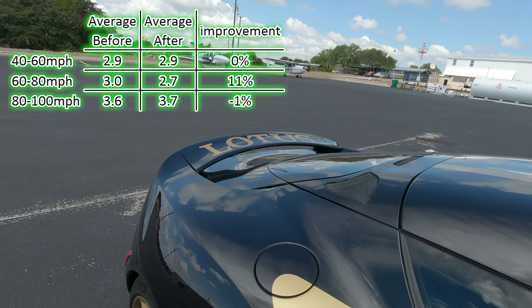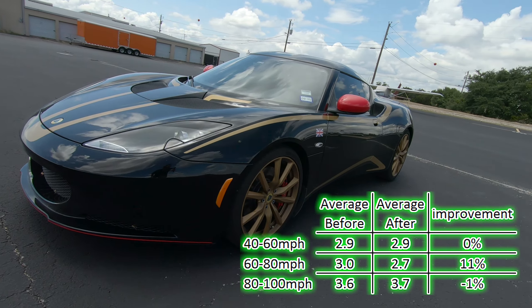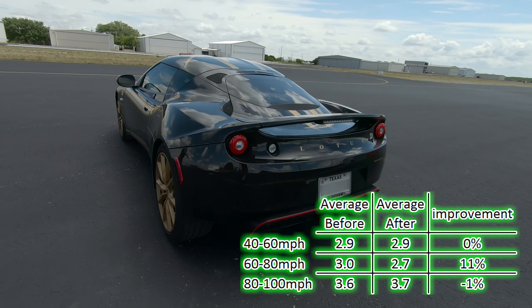That's pretty incredible. How do you feel about it? I like it. It's not an annoying sound — it adds a little extra dimension. Plus, 11% on the mid-range pull — that's pretty good. In my book, I think that's what I was feeling earlier that I was hoping was reality, and it seems to be. After crunching the numbers at home, we can see that there was zero improvement on both the high end and the low end of the power band. However, the 11% improvement in the mid-range is pretty significant. Hopefully this helps any other Lotus owners make a decision on this intake. Thanks for watching, please subscribe.